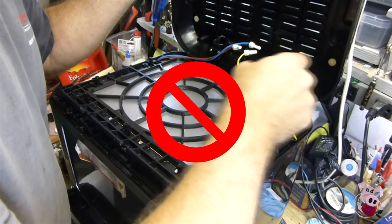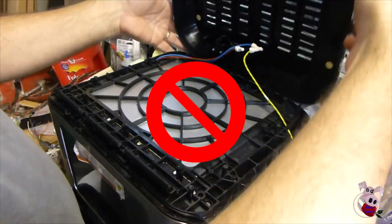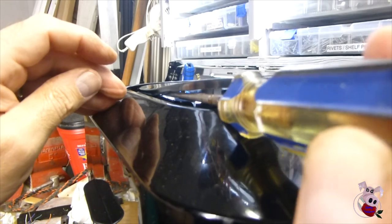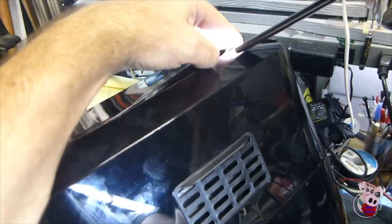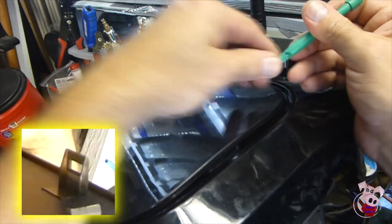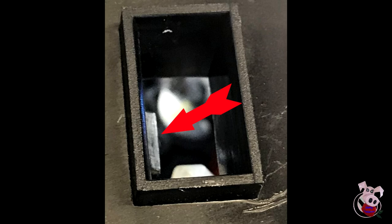To get to the bulb or the thermal fuse, there is no need to open the bottom of the unit as I did to investigate how to gain access. The electronics are under the cover, which is clipped in with six locking tabs on the top and three ridge clips that hold the front. You're going to need some patience with this. I used a long flat screwdriver.